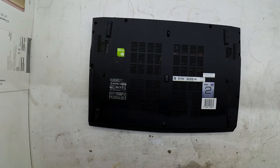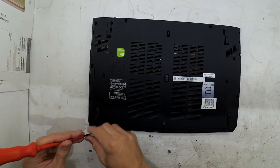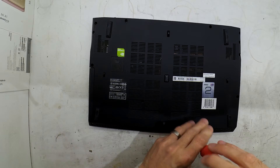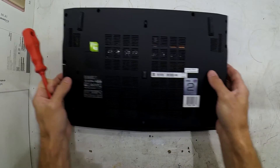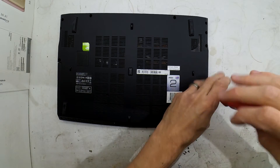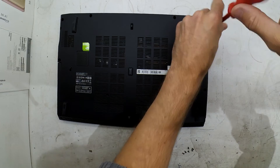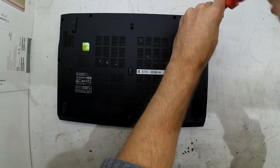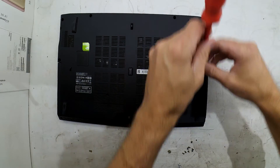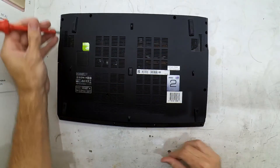The current plan with this one: I'm going to use a Phillips head screwdriver and open it up, then replace the standard Western Digital hard drive in there, which is a 1TB WD Blue running at 7200 RPM. That's going to be changed over to a WD Green 480GB SATA SSD. Being that this is an i5 with 8GB of DDR4, replacing that hard drive is definitely going to yield a great improvement of usability on this machine.